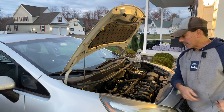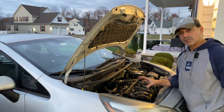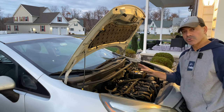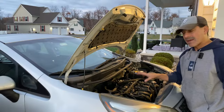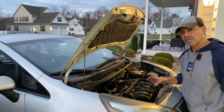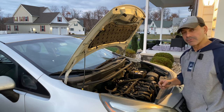So we took a look in there. The catalytic converter shield looked a little bit cracked up. Normally it should be a smooth honeycomb look — as seen here, this is a good catalytic converter. You can see how the honeycomb screen is nice and clear, flat and smooth. That one looked a little bit rough. I'm going to try to run some cleaner through it and see if that helps. If not, it may just need to be replaced.